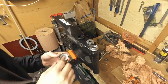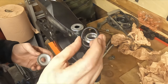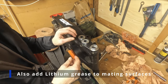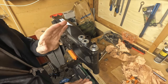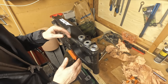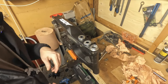I forgot to mention — in the cups that protect the bearings, the seal sits in the cup. You can remove this seal, clean it, and then insert it back in the cup and it's ready to go. Now everything is spotless — I haven't greased it yet. I'll grease it now, put all the sleeves and caps on, and then store this until I replace my chain. I have a closed-loop chain which requires taking off the swingarm to replace it, so I don't need to break the chain.